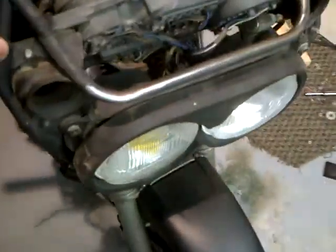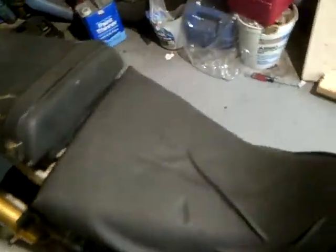So from the start, we got a working key. We straightened out the headlight assembly right here, keyed up the ignition, matched it to the gas cap, and made a little makeshift seat right here. Removed a horrible half-broken spark plug, completely redid the carbs, cleaned those things out. It's a whole deal. Charged up the battery.